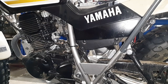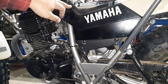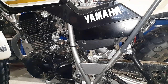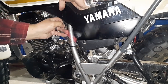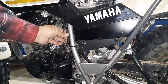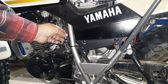The first thing we're going to do is look on the bike and find out where we want the tender lead to come out. I want mine to come right across this rail right here, so I'm going to have to come in behind this side cover. I'll take my tender lead, push it up there behind the side cover, and there's a little section behind it that will come out right there next to the frame rail. We're going to zip tie it right there to the frame rail so it'll be nice and tucked away — a nice clean look is what we're going for.